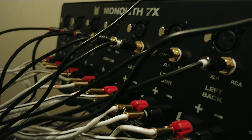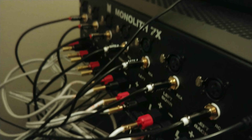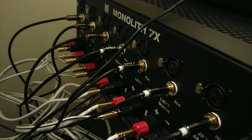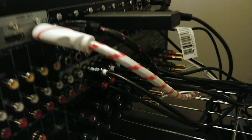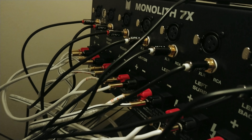Depending on what you're powering, you'll plug your RCA cables into the front left and right pre-outs of your receiver, then do the same thing on the other end on your power amplifier. So if I'm plugging in front left and right on my AV receiver, I'll come to my Monolith amp and plug the same cord into the front left and front right. For the center channel, you'll only need one RCA cable, because the center channel is one speaker — not left or right, just one speaker — so you plug one RCA cable into the center pre-out of your receiver.